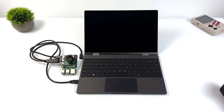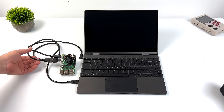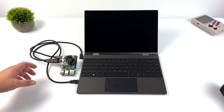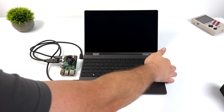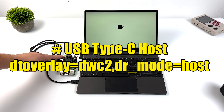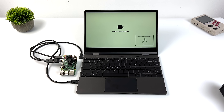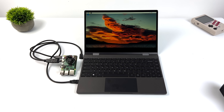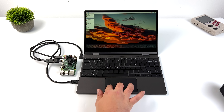This also supports the Raspberry Pi 4, but there are a few things to note. We have to connect it differently because the Pi doesn't have display over USB Type-C, so we need to connect a USB cable to the power port on the NexDoc and a separate HDMI cable. I'm running Raspberry Pi OS, and in order to get the keyboard and trackpad working over that USB Type-C cable, you will have to add the appropriate line to config.txt. Once it's connected correctly, you can power it up and use the trackpad, keyboard, and touch over USB Type-C.